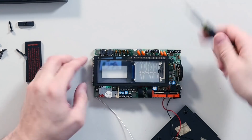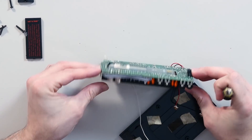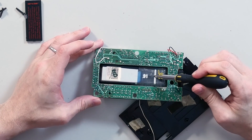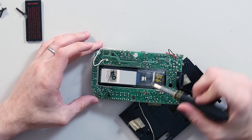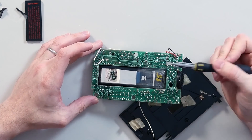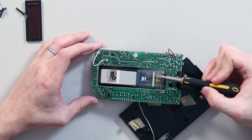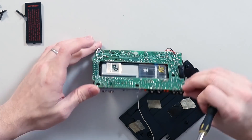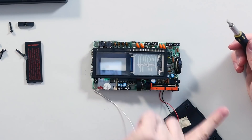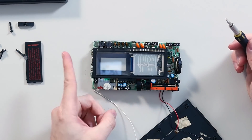Along here you have all the steering magnets and steering mechanism. You can see on the back that some of these steering mechanisms are quite loose. You've got the horizontal and vertical scanning lines which fire across, and there's a permanent or electromagnetic field going front to back which curves those electrons down onto the screen.